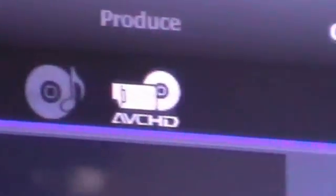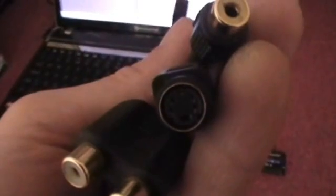Now we're ready to record, even though we haven't got any cables in yet — you can see it's got a blank screen. It detects it as an analog source, and you can see it also does HD cameras, webcam, and it's got the built-in microphone on the laptop so it will record microphone too. The capture card itself comes with a USB dongle that has left and right audio, S-Video, and Composite. Composite is the standard yellow one which I personally would use over S-Video.